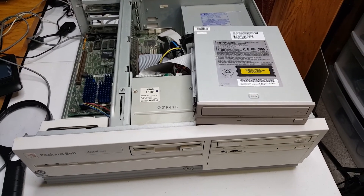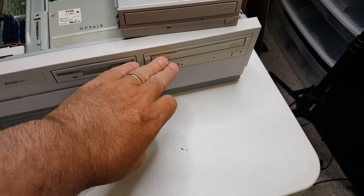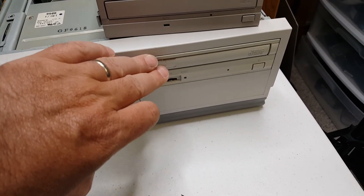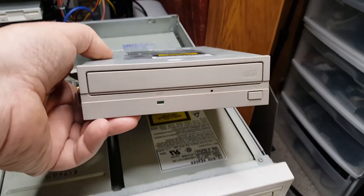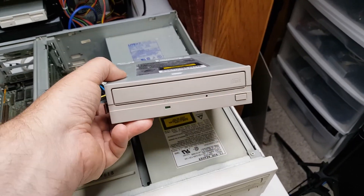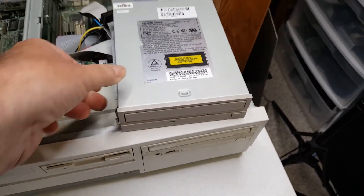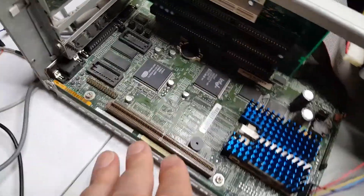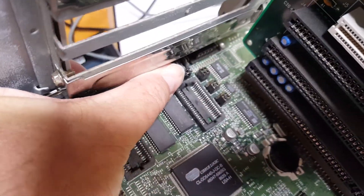As a wrap-up, I'll show everyone what I wound up having to do to conduct all these benchmarks. First off, the quad CD-ROM that came with the XL system — I do believe it has a failing drive belt, those little rubber bands in there — it just wouldn't stay spun up. So I swapped it out with an old quad-speed generic CD-ROM drive, an old Lite-On CD drive, and I managed to finish the benchmarking test with that.